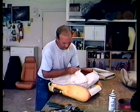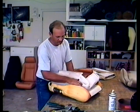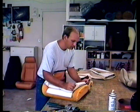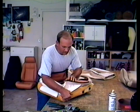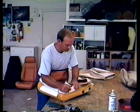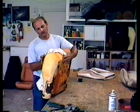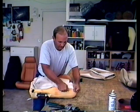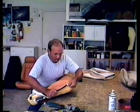Now you've got to roll the seat over the edges. This is called the salvage — you'll see a mark in the old foam where the salvage used to be, it's just at the high point of the bolster. Use your hands to kind of roll it over that edge so that the seam is right on the top, then roll it over the edge.